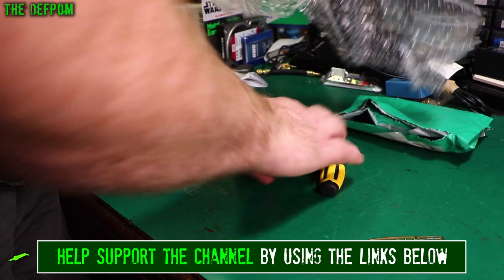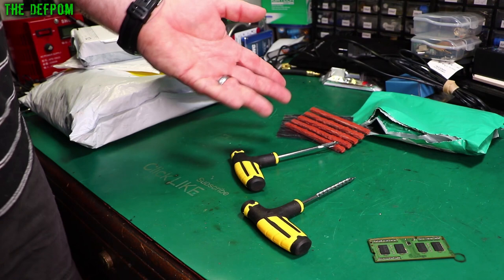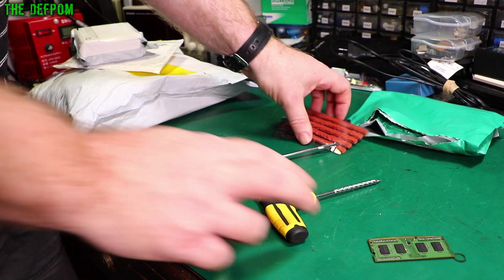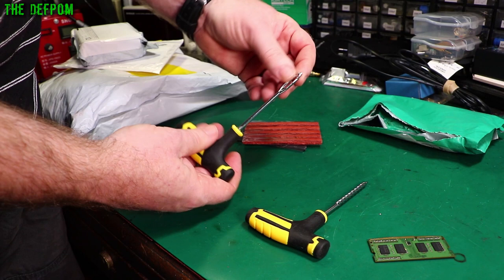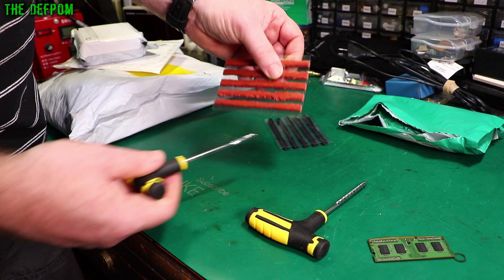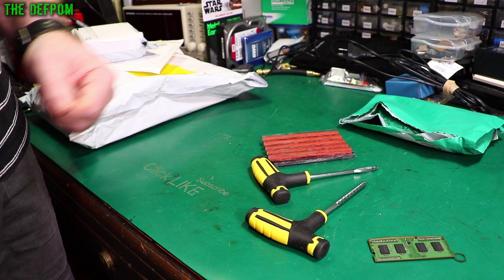So we have a tyre repair kit. I got this because Dave Jones had a puncture on his EV right before a service, and there's no spare — he had to take the wheel off. It got me thinking what I would do in a similar situation. With these kits, if you've got a nail hole in the tread, you push the tool through to clean the hole, then thread a rubber strip through the slot and insert it into the hole. Pull the tool back out and the rubber stays in, plugging the hole. Then you can pump the tyre back up. I don't know how permanent that repair is — I'd recommend getting it done properly — but it might get you out of trouble. They're not that expensive, so I'll chuck one in the car. Could save me trouble one day.